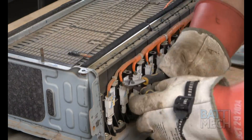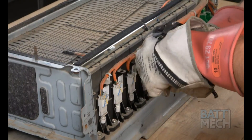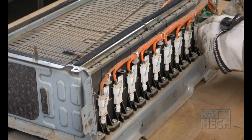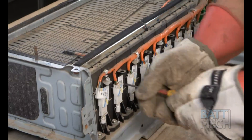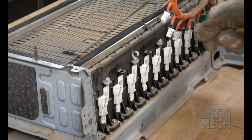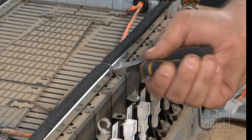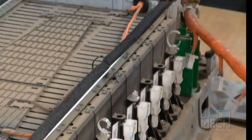Next, proceed to the other side of the battery pack and clip off the white plastic zip ties. Keep in mind, you will secure these orange wires during the reassembly with new zip ties. It's also important that you do not cut into the orange wires, as this will result in a large spark. Once the zip ties are clipped, continue by unfastening the white plugs as shown here. Then move to the top of the battery and clip the zip tie there. Be sure you have a few small zip ties on hand for the reassembly.